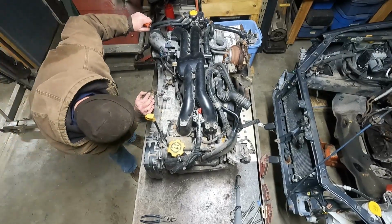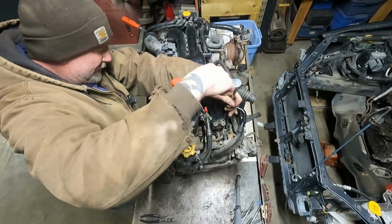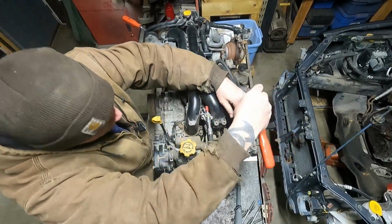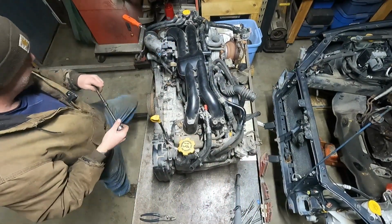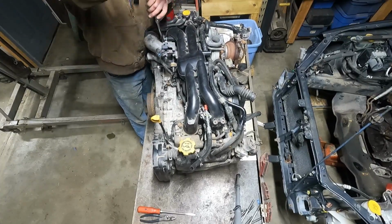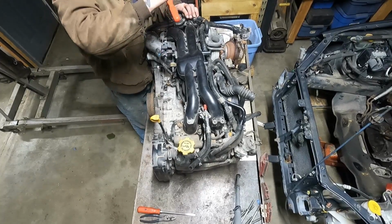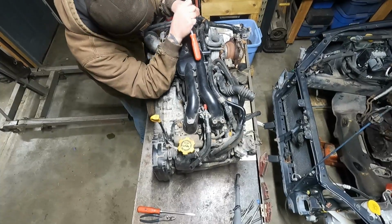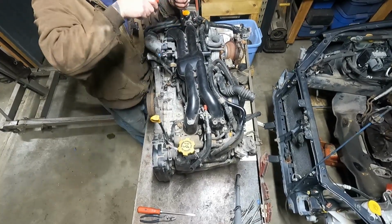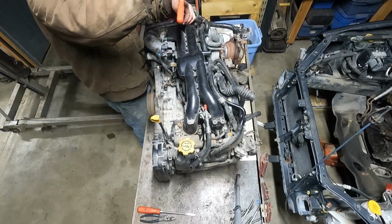Oh my gosh. What a mess of stuff. What the motor's been through. Like I said, if it got hot, you're gonna wanna replace all these gaskets and seals. They're gonna be all hard and crusty. It's guaranteed. Get it all back together and you start driving it, and a week or a month goes by, or instantly it'll start leaking somewhere. It'll be pissing antifreeze out or oil, and you will be kicking yourself saying, I was right there, I could have replaced that. It was so easy. But now I gotta tear half of the motor apart to get to that one gasket or that one seal.